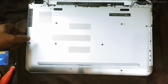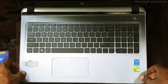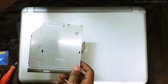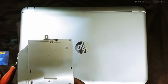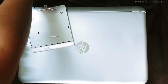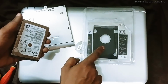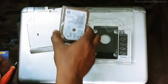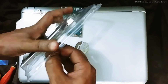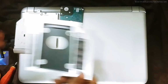Now you need to put the back cover on. I did not put these screws just in case I have to open the laptop again. Now you need to install the hard drive that we took out from the laptop. We need to install that onto the DVD caddy that we purchased separately just for this purpose. I will leave links in the description for all these items, so please do check them out.